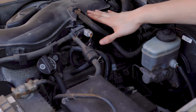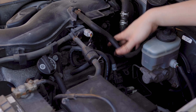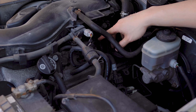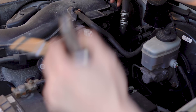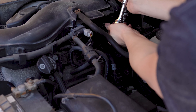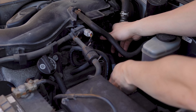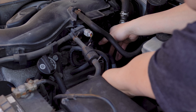Jumping over to the driver's side, it's a little bit trickier only because there's a bunch of hoses and stuff in the way. But the process is essentially the same. I'm going to go ahead and remove this support bracket here that's held in with two 12mm bolts, and that's going to give us enough room to access the coil packs, unclip them, unbolt them, and then get the new spark plugs installed. You can probably just get away with loosening that bottom bolt and moving this when you need the room, but I'm going to go ahead and just take the whole thing out.